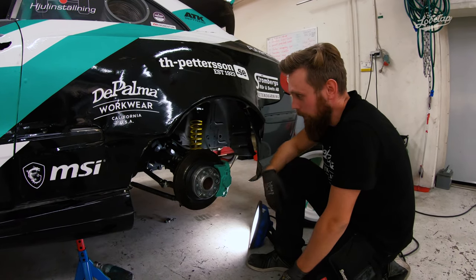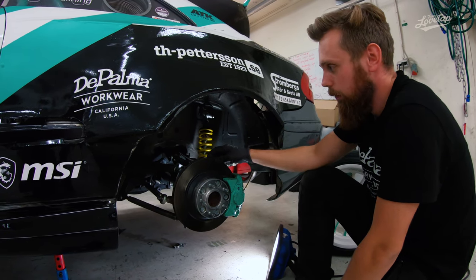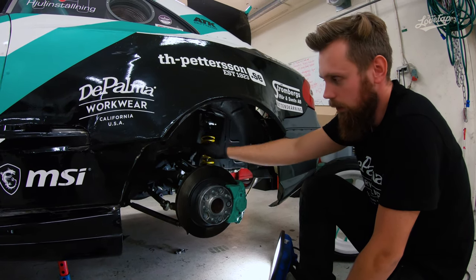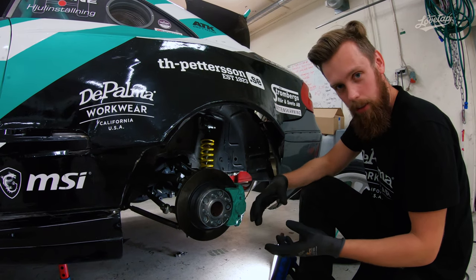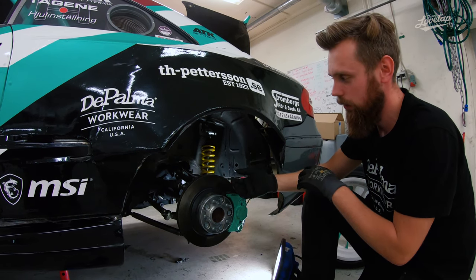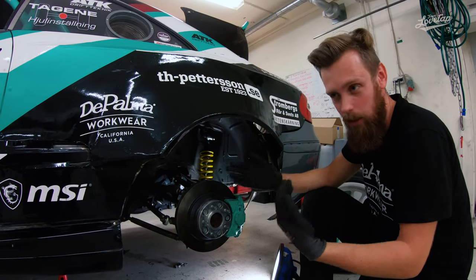Now we're at the rear suspension. This is a 500E brake caliper — I think from early 2000 — with a 297 millimeter disc, and we have a bolt conversion here as well. Something a bit special: we have a stock CLK spindle, but a BMW E34 hub assembly — the hub from an E34 and also the E34 inner hub part on the inside. That makes it possible to run a driveshaft from a 540 E34. We made a custom length shaft because the car is so much wider than the E34.